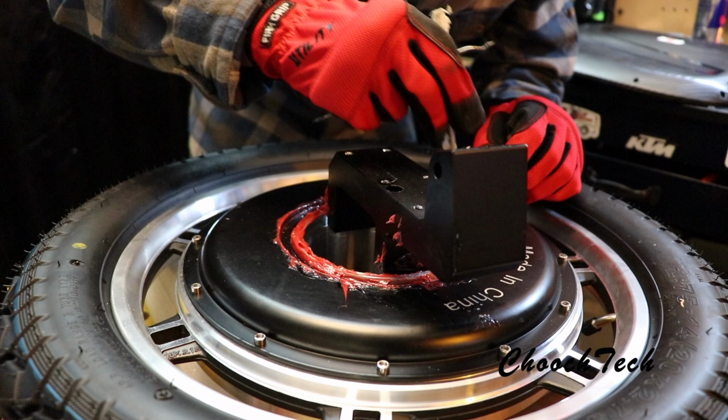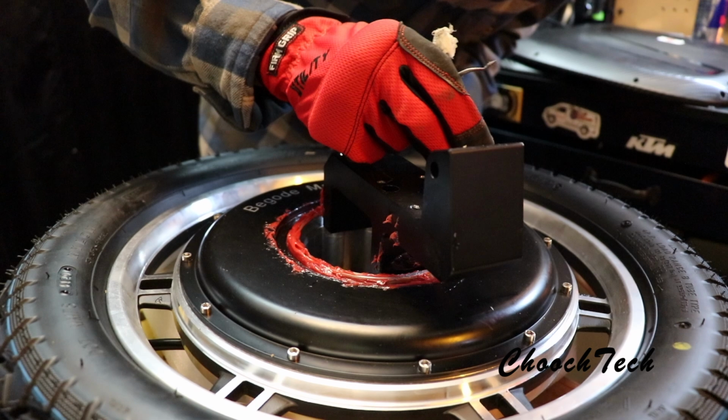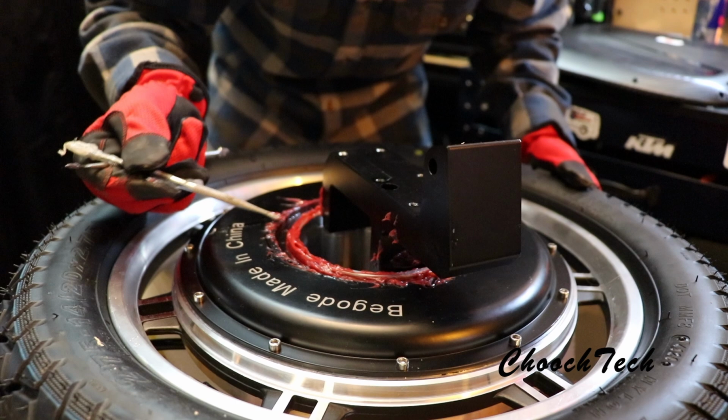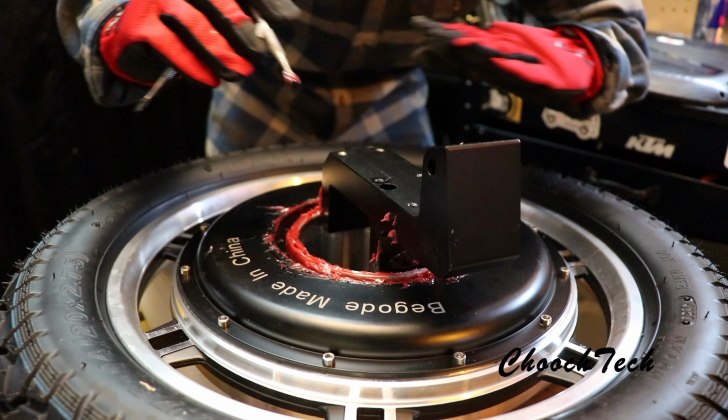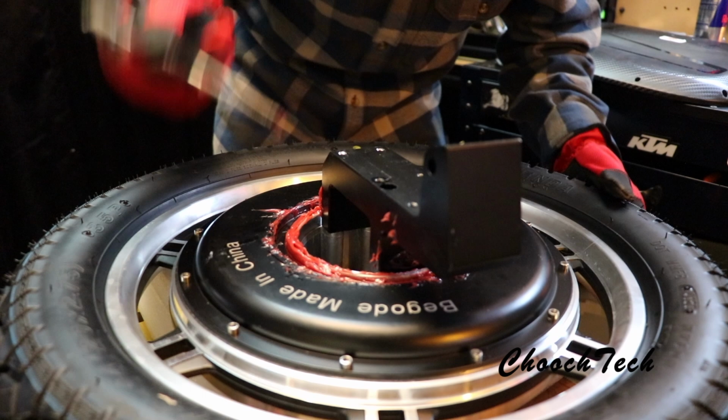We just want to get this bearing seal down here, on here, like this. You can just work it around. Work it down. And I'll show you how to remove it on the other side. I probably should have shown you that first. Removing it's pretty easy. You just get under it with a tool like this, and don't bend it. Don't just pull one side. You got to think of it like something stuck to something that's moist, you know? You got to really get all the way under it and pop it off. You can't really just pry one side because you'll just bend this seal right here. You know what I'm saying?